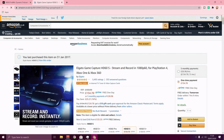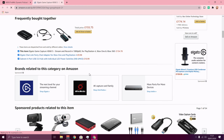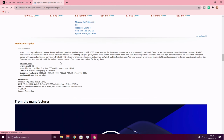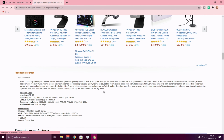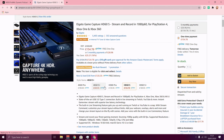So what's nice about this is the HD60S will record in 1080p 60 frames per second at a kind of maximum level, which is quite nice. And then it has a pass through. Let me just double check this, because I think I've forgotten since then, but I believe you can pass through at a higher, no, sorry, the pass through is 1080p 60. So what you have to bear in mind there is the pass through, when we talk about that, is the signal out of this box which goes to your TV will still only be 1080p 60 frames per second. Now, for a lot of people, that is absolutely fine. There's no problems there.